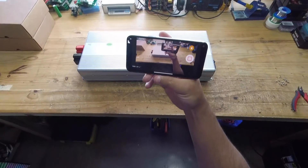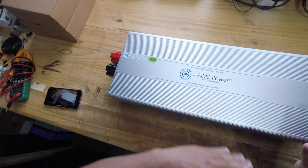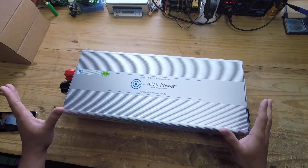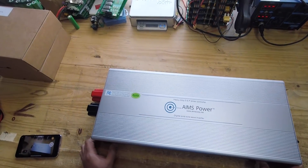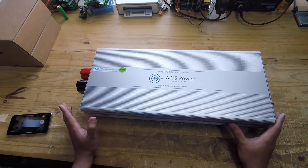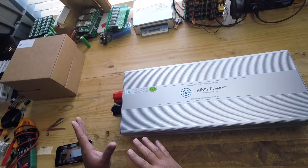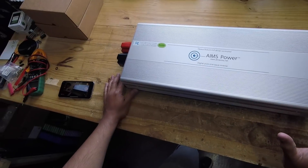Okay, let's do this — this is going to be a very quick video. Here's what I'm trying to do: I'm trying to charge, or make a portable charging system, for a Tesla car. That's not easy to do because Tesla charges at a very high rate — up to seven and a half kilowatts — and so that requires a giant inverter to make DC power into AC power so it can then charge the Tesla.